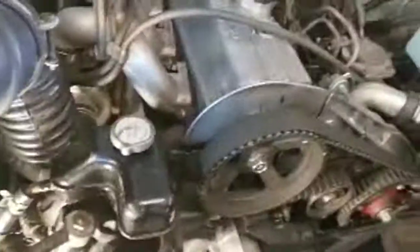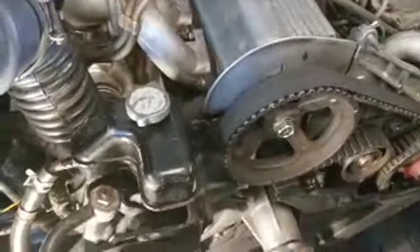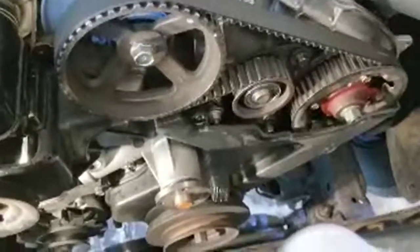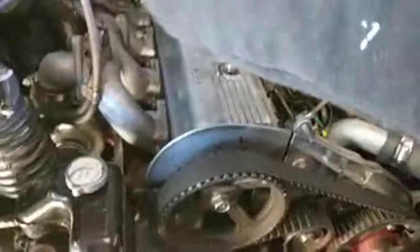So, we're getting closer. Not there yet. I'm just thinking what is next. And I'm checking that gear because I don't think that one's stuffed, but it could be. And if that gear there is stuffed, then I'm in trouble even more so than before. So I'm just in a mood of thinking, what's the next step? So the next step is I've got to crack this bolt. So that means a good thing I didn't put everything back together again. It means I got to take the timing cover off again.